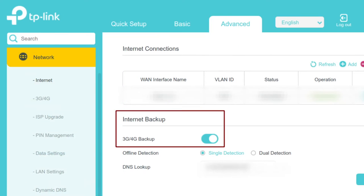The second thing: go into Network and then click on Internet, and there's an Internet Backup switch. This is all inspired from TP-Link's documentation, which is available on their website. Go into Advanced, click on Internet, then you see Internet Backup. The first change flips the router on its head, and this one flips the backup on its head.